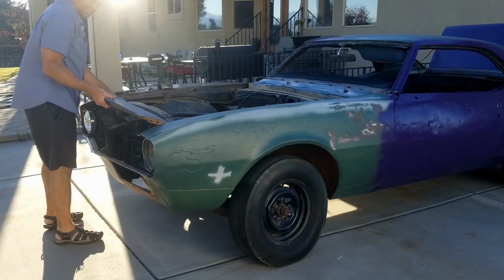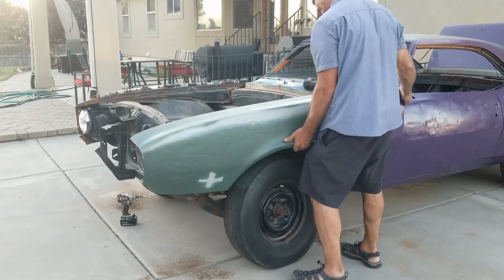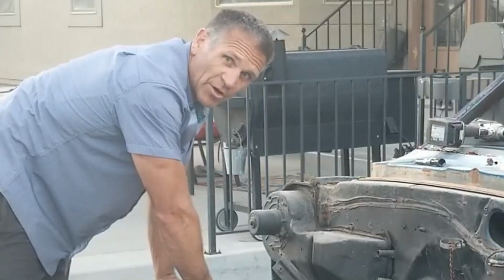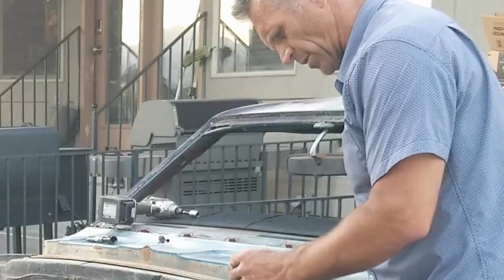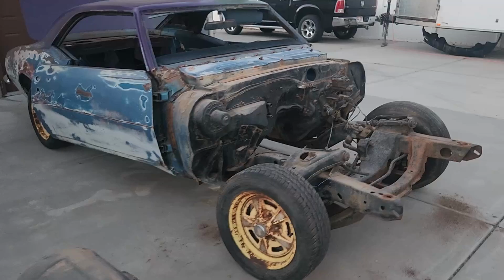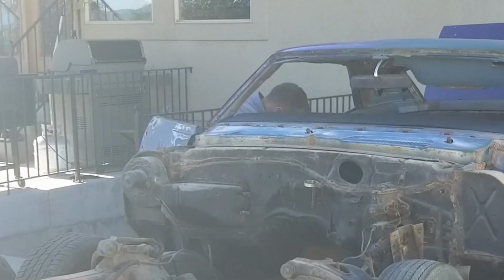The plan of attack is this. Number one, pull the front clip. These fenders probably go in the garbage can. Take note, two spacers on each fender. Nope, three spacers on this fender. So all this comes off. At that point, I can work my way through the frame portion of the front clip, pop the steering box and the steering column. I like the more modern steering ratios, and so probably that steering box is garbage.